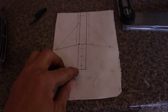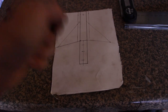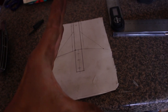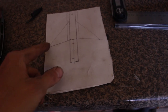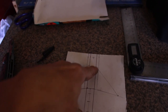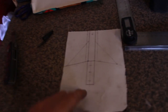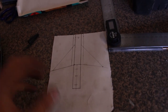We measured the amount we want welded on the bulkhead with three points measured to drill holes for plug welding, spot welding. And then these flanges at the right angle, hopefully, to sit off, which is not 90 degrees off the bulkhead, it's just slightly up. And then what we'll do is we'll cut this out, and those will come down to here, folded in, a little flange either side at the top to keep the strength at the top. And that's the design, that's the plan. So we'll cut this out now, fold it into shape, maybe use a bit of tape, see what it looks like on the car, and go from there.